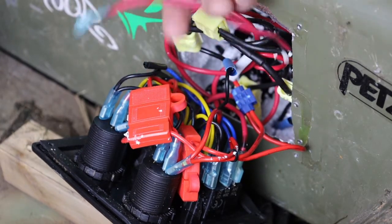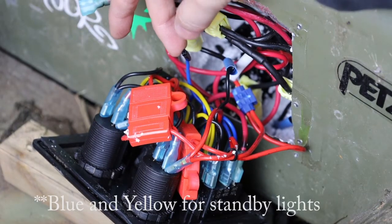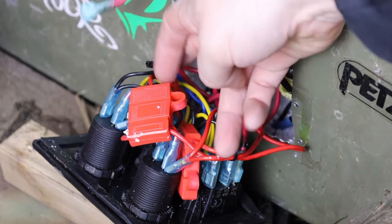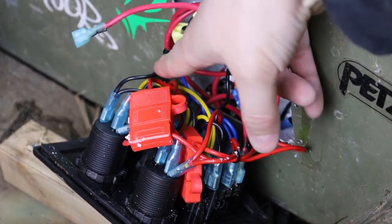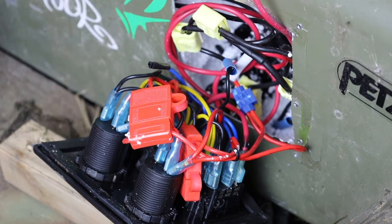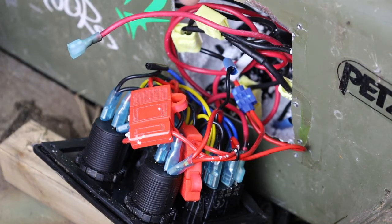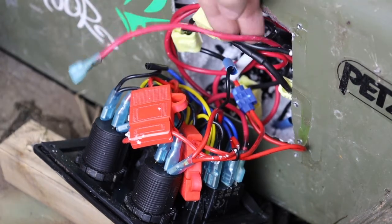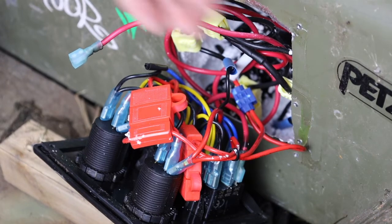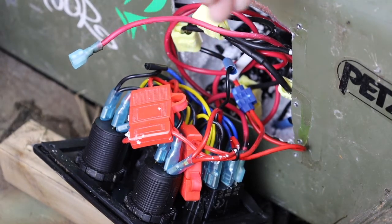Here are your two fuses. You can use this blue wire — these lights let you have an indicator on when the switch is off so you can see where your panel is. I don't need that because I've got one battery and it just killed the battery, so I just leave that unplugged. Other than that, it's plug and play. You've got your two wires, all your grounds are connected — they're all connected to the same spot. Once you're done with all that, I took it all into the seat, shaved out some styrofoam, cut a square, and the wiring comes up from underneath the seat.